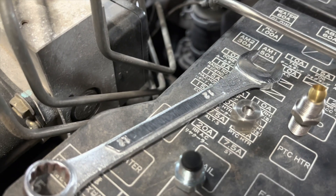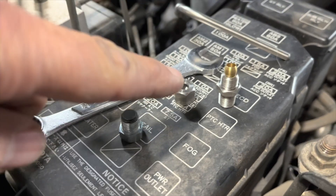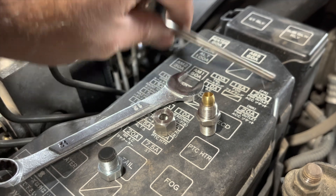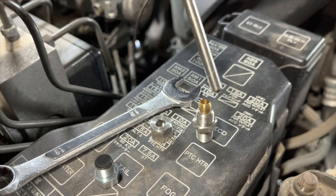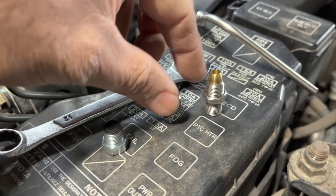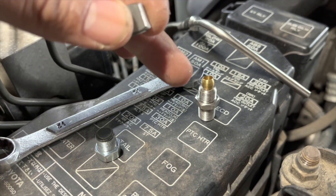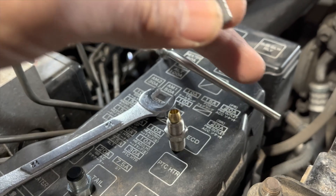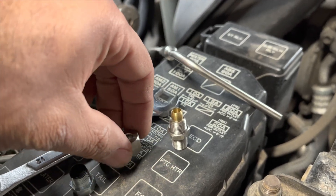So you need a 12 millimeter to get off the plug, and then also these two are 12 millimeter. When installing the probe, it goes through this little copper sleeve, and then that's on the downpipe. This crushes the little copper washer to hold the probe in place however length you want it sticking in there.